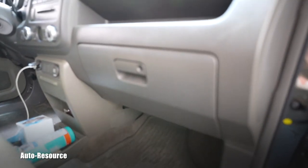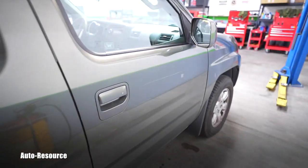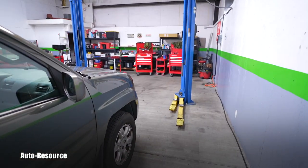Watch the marks so you don't put it upside down — it fits this way. Now put it back, using one hand while the other holds the glove box. Watch the marks — it will click. You hear that? It's inside. Now reinstall the tabs: when it's partially closed, put them in — did you hear that click? Move it forward a little and click them into place. Check that it's securely seated and return the contents inside. We are done in this area.